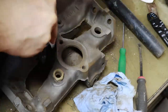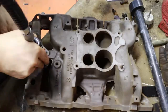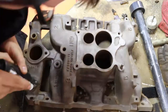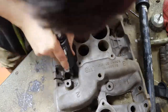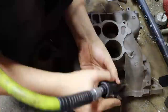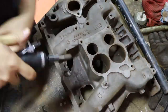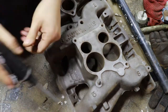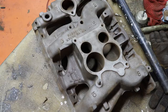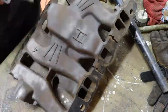A lot of these Pontiac intakes and old intakes in general have a lot of casting flashing — that's just the material left over from the casting when they poured the metal in. What we use is a carbide burr and a sanding roll to make things nice and smooth. I did have to get in there with a long carbide burr to get some of the nooks and crannies — I'll link those in the description below. If you do buy a die grinder, I suggest buying a halfway decent one. The main reason is you're throwing something around at 20,000 RPM potentially — you want a good strong collet and something that's not going to fling a piece of sharp metal across your shop. I've had that happen a couple times with a cheap die grinder, and I was not very happy with it going across my garage and potentially injuring somebody or something I paid a lot of money for.